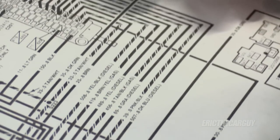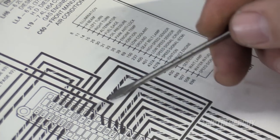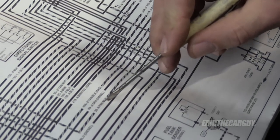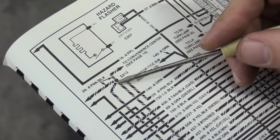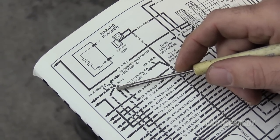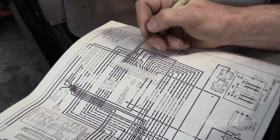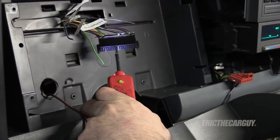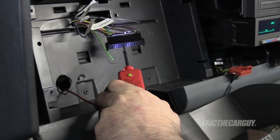Now I need an ignition hot source. Looking on this list, I'm finding a couple. Circuit 39 — ignition coming out of here — and it's going to be a pink-black wire. If I continue to follow it over, it goes to a power distribution that goes out to a few different things, but that's a nice ignition hot. The other one I found actually goes to the brake light circuit, and I'm happier with this one. It is one, two, three, four, five, six, seven, eight down. So here's a pink-black wire on the other side of that. I'll turn the ignition on — it's on. Definitely ignition hot.